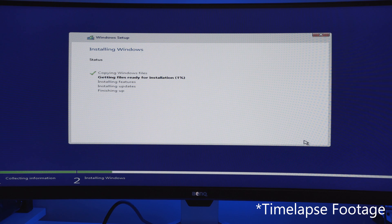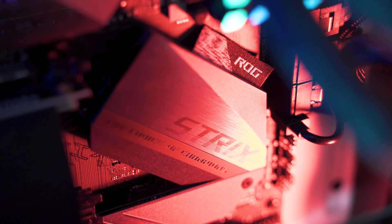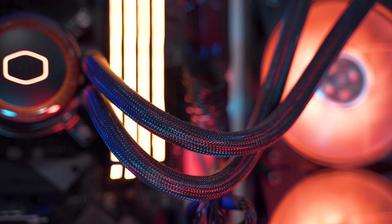For those who want to use this as a boot drive, provided you set up the partition as master boot record at the beginning, you can install Windows like you normally would. I tested this by creating a Windows 10 installation media using a USB flash drive, booted from it, selected the adapted drive, and successfully installed the operating system. Just a word of caution though — I have heard that some people are having trouble using adapted drives as OS boot drives under certain hardware configurations. It worked flawlessly for me on my ASUS Z390 ROG Strix motherboard with an Intel Core i9-9900K, but your mileage may vary.